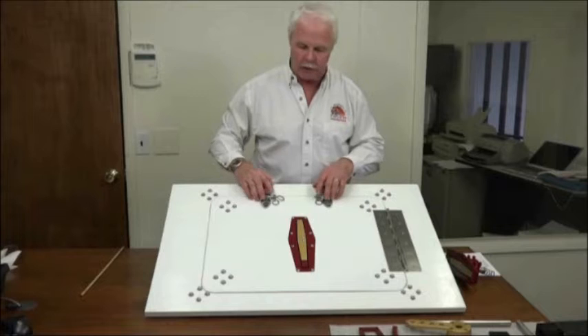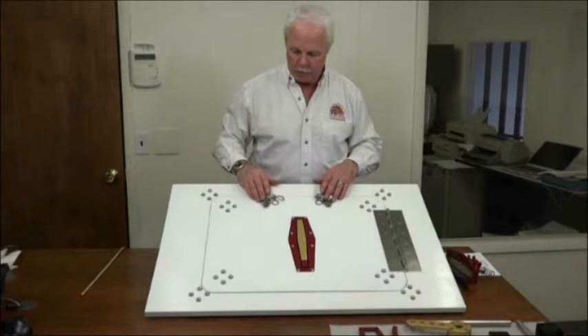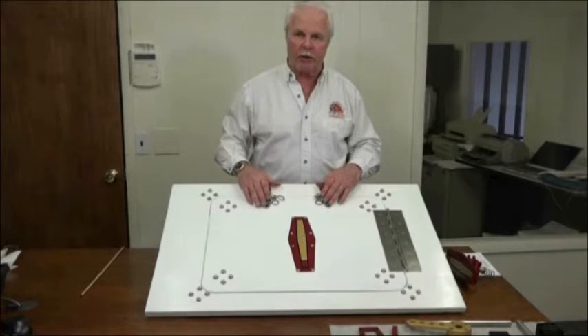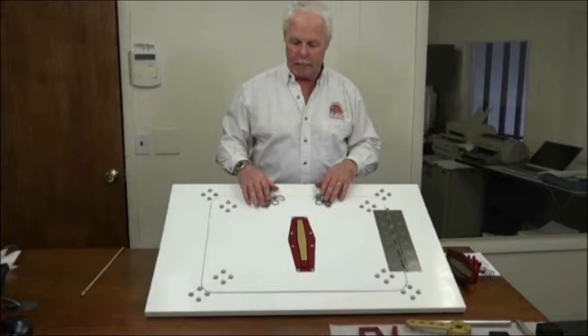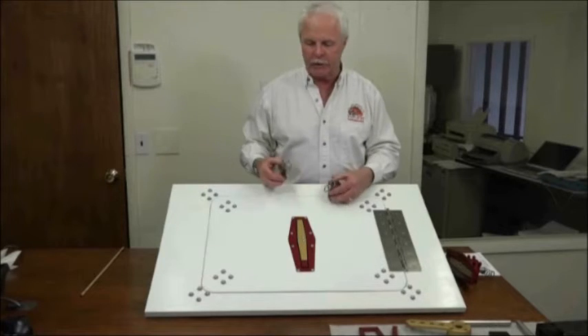The safety hinges can be further attached with lanyards into the cockpit, so once the door is unlatched, you can pull the lanyards from the inside to remove the hatch completely, or remove it for servicing by pulling the quick pins. Both methods of hinging are offered — safety hinges or piano hinge. With a four-point locking system, the hinges are not actually securing the door; the pins are. The hinges simply allow for opening and closing the door once it's unlatched.